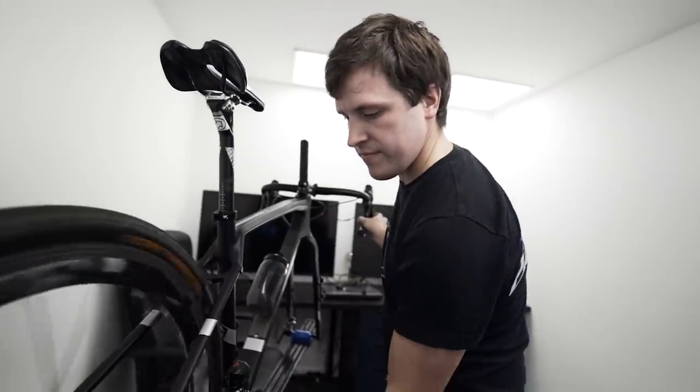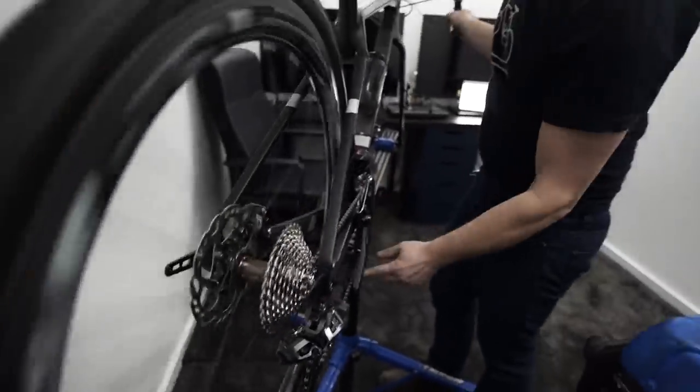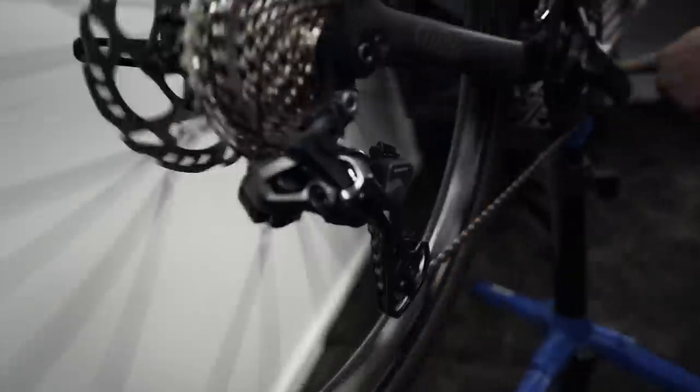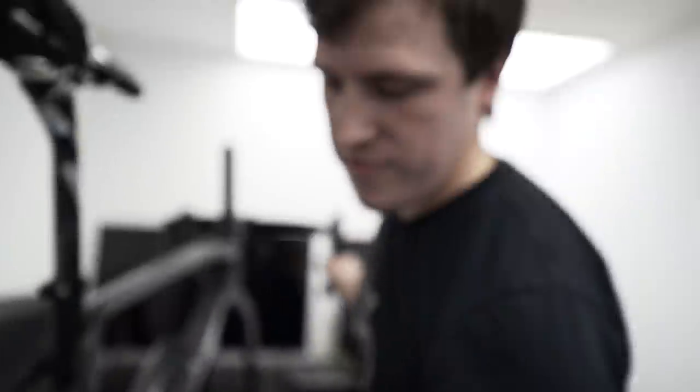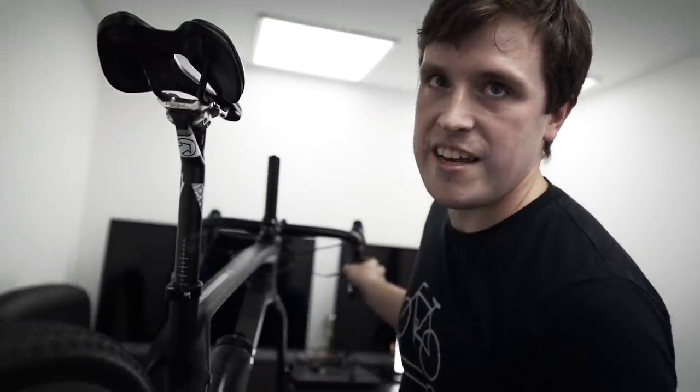Not bad — have you used it before? No. The chain doesn't bounce around. Quite nice — it's got the clutch. You can turn the clutch on and off. It's not ideal. Why would you not want it on all the time? If you do a wheel change, it allows you to move the mech out of the way easier, because obviously you're on the clutch — it's like you'd end up trying to rip the wheel out, but it comes out easy with it off.